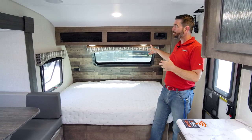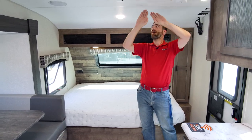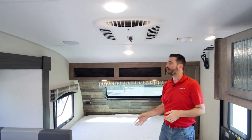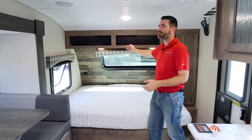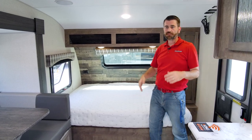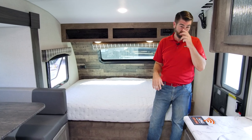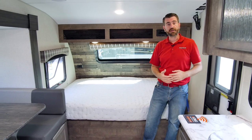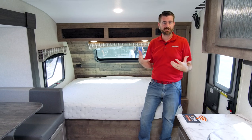Speaking of our front cap, that's the one place where we have exterior construction differences. So our roof is framed up and trussed with aluminum trusses. Our side walls are aluminum frames, but our front cap, because it's radiused, is harder for them to get that nice curve. So they use wood to frame up the front cap. So it's a combination of construction techniques to accomplish this here. And all of that, of course, is using that nice radiant foil barrier as well as that nice heavy insulation that we would find in a home. It's that fiberglass batten. You've seen it before.